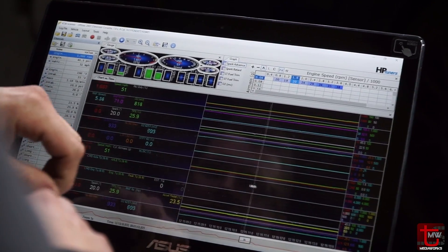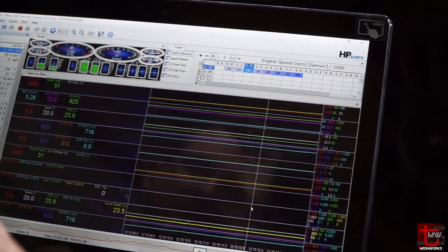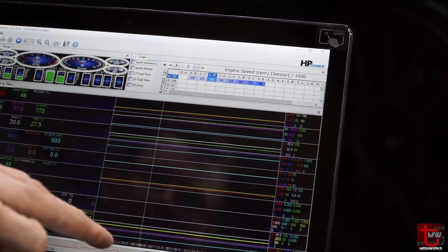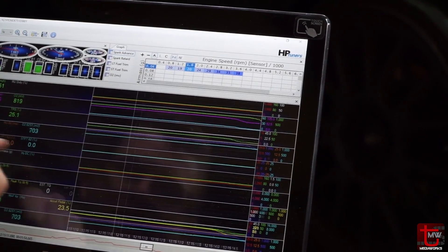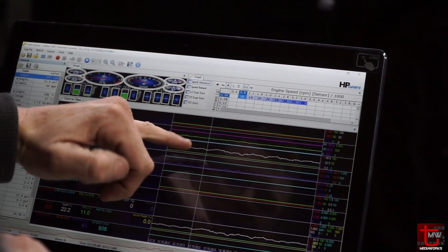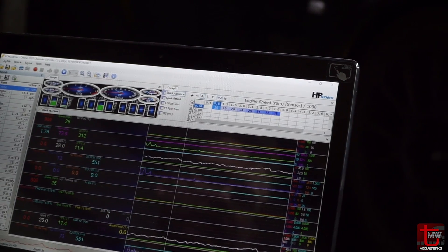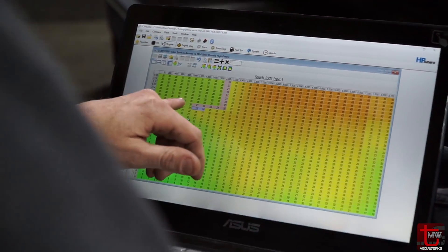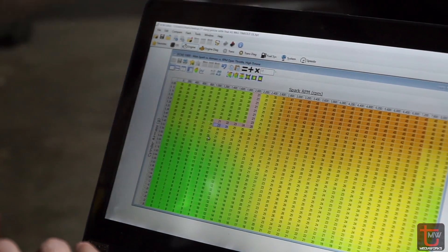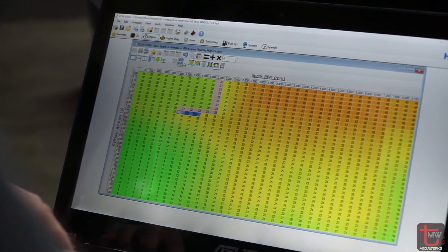Here's some similar highway cruising at 50 to 60 miles per hour. You can see right away — everything is flat. Everything is flat, just dead stable at 1600 RPMs. Moving across in real time, that's like 10 seconds of cruising at 1500, 1600, 1700 RPM — and there's no saw-blade pattern. Follow the white line everywhere. You see kind of the artifact of it wiggling but it doesn't have that jagged shape. This is good operation.